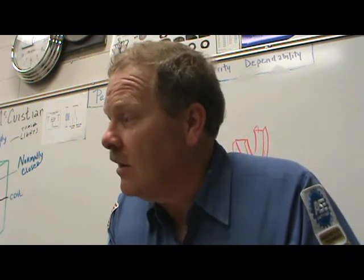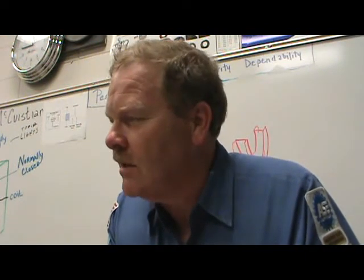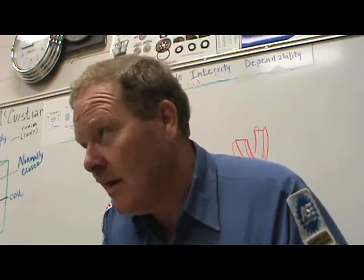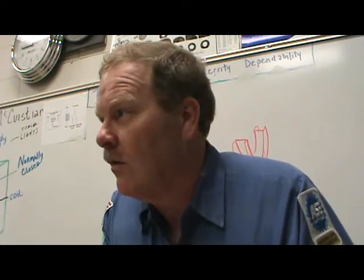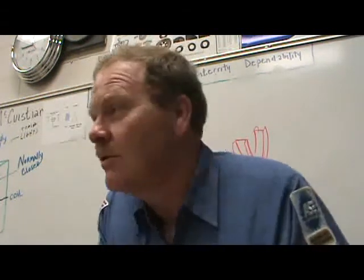You better get you some doggone masking tape and write some numbers or something. 1, 2, 3, 4, 5, 6, and that will save you so much time. I'll tell you something else that works really good that nobody here ever does, except George Reyes. He would do it. Find all the little cups and buckets and whatever, coffee cups, and write stuff on there: manifold bolts, water pump bolts, timing cover bolts. Put those on there.